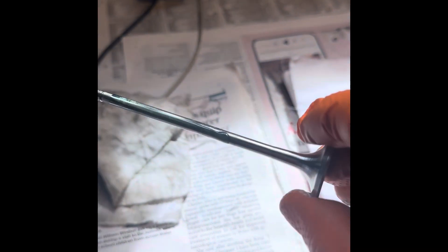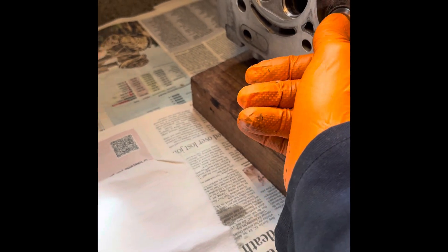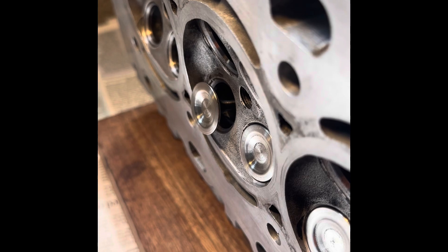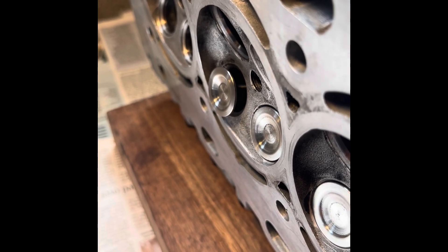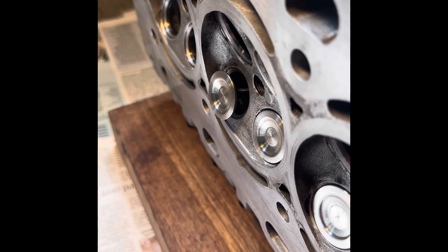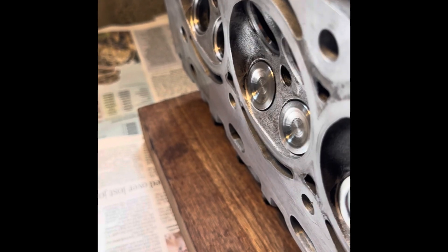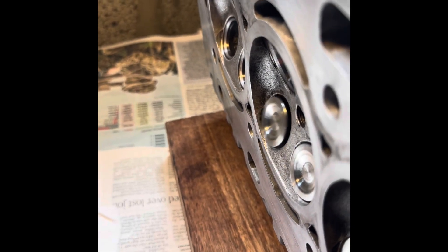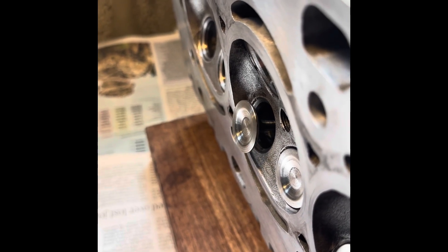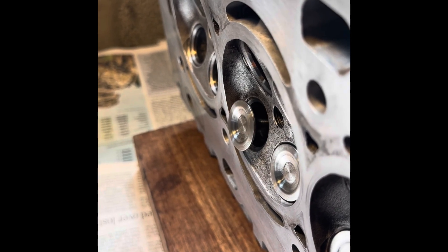So I've put the Lucas assembly lube on there, put it into the valve guide, push that in - but that's not good enough just like that. Now what we've got to do is rotate that valve. Keep rotating it because the oil will only be on one part of the valve stem and won't have much effect. So what you need to do is rotate that valve, spin it, and then you'll feel the oil goes all the way around and suddenly the valve goes up and down with no feeling of scraping. This is all to save it for startup because there's no oil in it. Now you can feel - that's a lot better, that's all uniform.